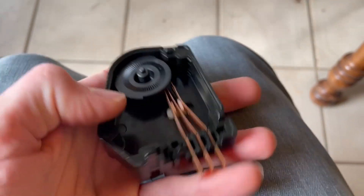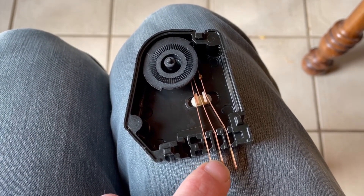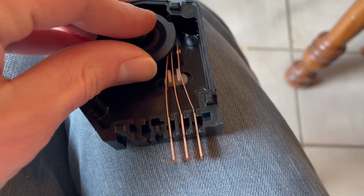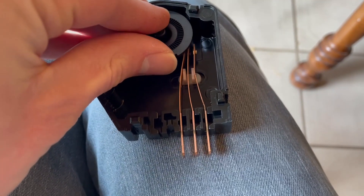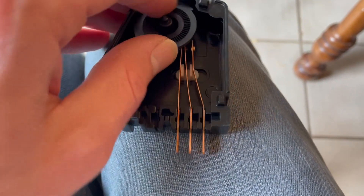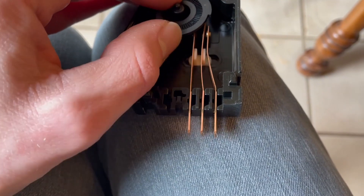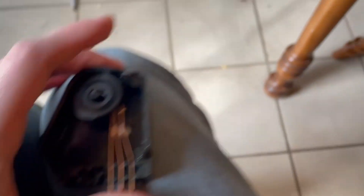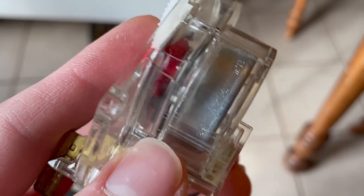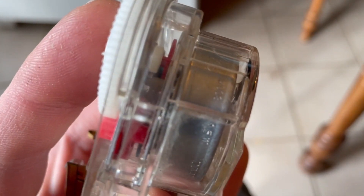At this point it'd be fair to just buy a new defrost module, but I wanted to see what's inside. The left two pins connect to each other in cooling mode, and the right two pins are for defrost mode. As you spin the mechanism, the left two are connected for most of the rotation, then it pops and the right two are connected briefly for defrost, then back to the left two. Something I'm noticing is that as you turn it, the resistance gets more and more right up until it pops. It could be the motor is weak and got stuck, or the gears aren't oiled well anymore — there's certainly a whole gear set in here since it moves very slowly.